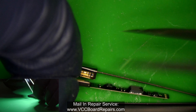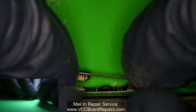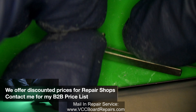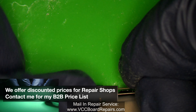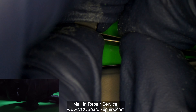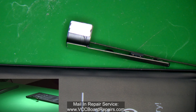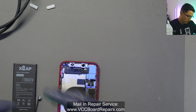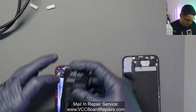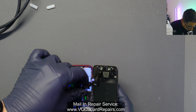It's very similar to the tag-on flex designed for Face ID — it folds back and this one has a new connector that you push together to make a tight fit. You only need to leave this on until you get it working and then you can remove it after. Now we're near the end. Make sure you push this all the way up otherwise the battery may not fit. For a quick test, I'll plug everything in — it's a little tricky with this tag-on flex. I'm going to get this battery plugged in first and then try to fit it into the housing.